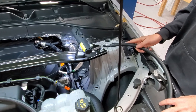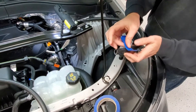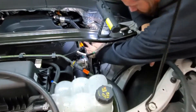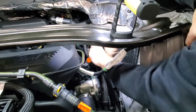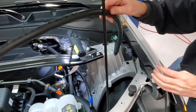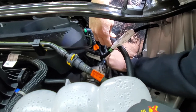We're going to want to route our hoses down so they're easy to grab from underneath the vehicle. The first one I'm going to route is the one that's going to go to the PCV connection — the other side of the OEM hose. I'm actually going to put a piece of tape on this so I remember which hose it is when hooking it up to the can. This will be just for my PCV connection. To route this, there is a metal pipe. We're going to push the fitting between the metal pipe and this rubber hose. Then we're going to take our other hose that has our 90 degree fitting on it and put that on the other side of the metal pipe — between that and the steering shaft.